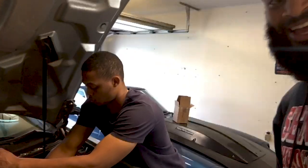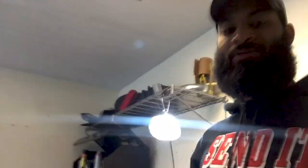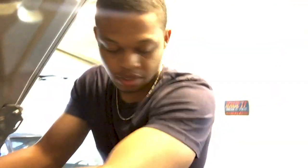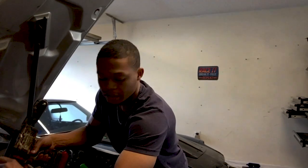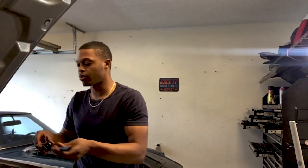Welcome back to Barbells and Burnouts. We're here with Josh in the garage. We're putting on valve springs — this is the last build part of the video. We're putting on valve springs, new seals, and different three-eighths pushrods. It's all there. Since I got it all open, I can do all of it at once — it's all right there.